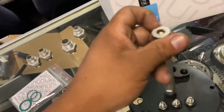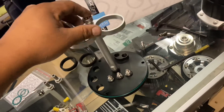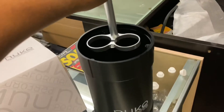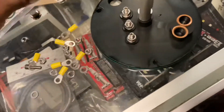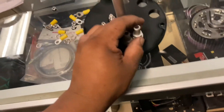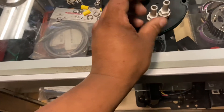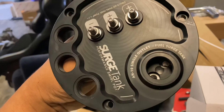This part screws into the bottom which gives you your height for your assembly. Then you take this off, run it through here — look at how easy that was. Now you have a setup for twin pumps in a surge at the right height so they're going to pick up perfectly. You're not going to have any starvation. On these we're going to have two o-rings that go on here for our fittings for our fuel pumps, feeding into your dash 10, dash 8, or whatever sizing you decide based on application and horsepower. Both pumps will feed to both fittings at the bottom right out of your outlet.